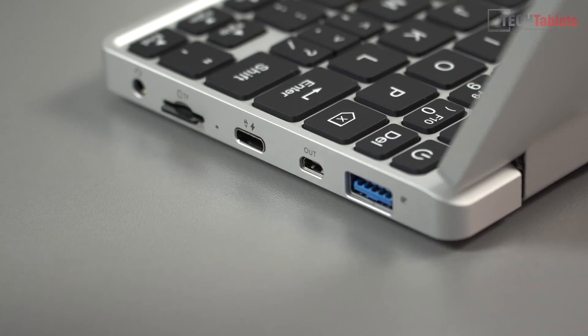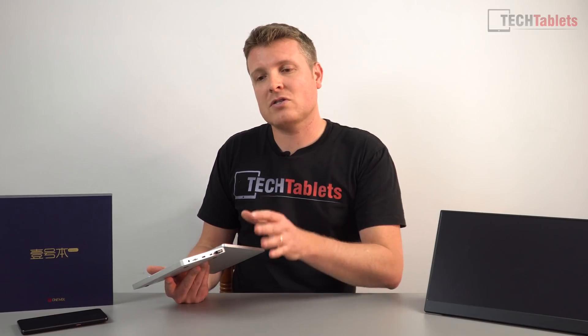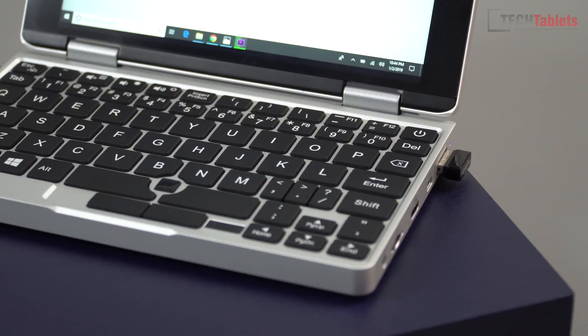There are no ports on the left side. On the right side there's a USB Type-A port at USB 3 spec, and an HDMI out — unfortunately only supporting 4K at 30 Hz, not 4K 60 Hz. The Type-C port is full USB 3.1 spec, but I couldn't get 4K 60 Hz with the Intel drivers. Interestingly, uninstalling the Intel drivers briefly gave me 4K 60 Hz, so the Intel driver appears to be limiting that. There's also a microphone, though it picks up a lot of fan noise, and a microSD card slot — unfortunately only USB 2 spec with a Realtek card reader.